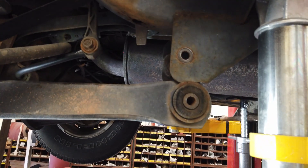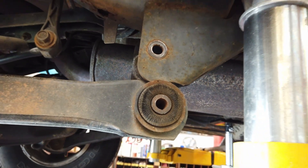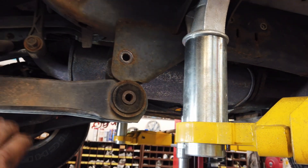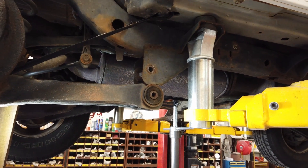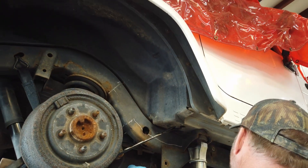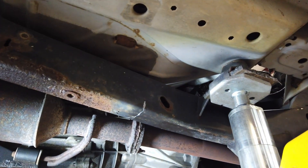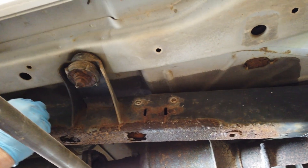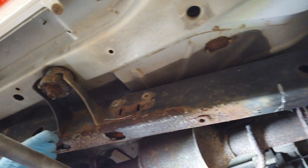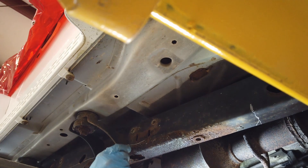One cool thing about doing a job this detailed is you can do some preventative maintenance. For example, this lower control arm bushing — we can tell it's dry-rotted and going bad. Go to your local auto store and proactively replace whatever you feel needs it while you're taking stuff apart. Use this time to do a full inspection, or have your shop do so as well. We're going through making marks where we know the frame is bad and needs to be cut out, using a piece of chalk. There may also be some usable parts of the original frame we can leave and let the kit strengthen.